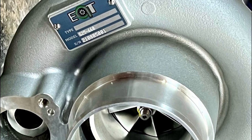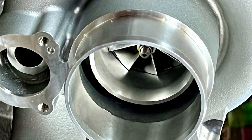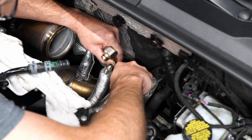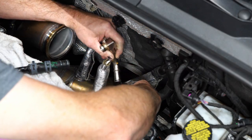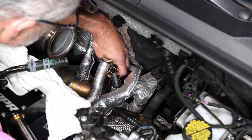Primarily, the difference is going to be the connections for oil feed and then the oil and coolant return lines. We're going to swap those out from the factory turbo. One thing to note: coolant leakage. When you're messing with the block lines, even if you've already drained the coolant, you're going to leak some coolant. So be prepared for that.